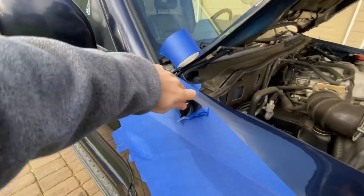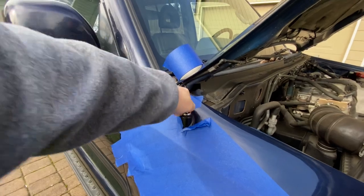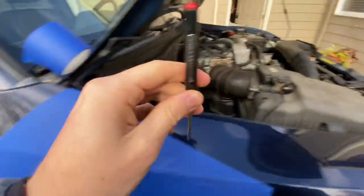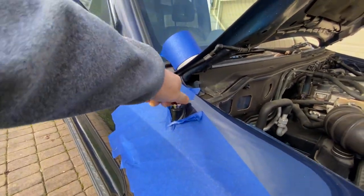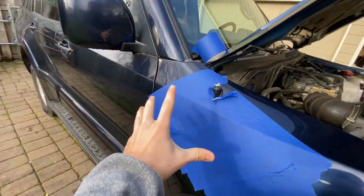In my case I have the limited edition so it comes with this automatic antenna. So you're actually gonna want to remove this one. I just put a little flathead screwdriver right in there, tapped it a couple times and it loosened up. And you literally just twist this one off. So I'm gonna get this removed and then I'm gonna get the template mounted up here exactly where it should go.